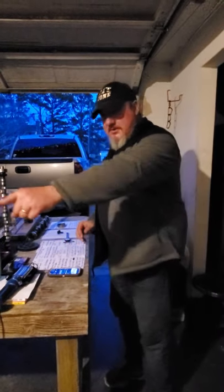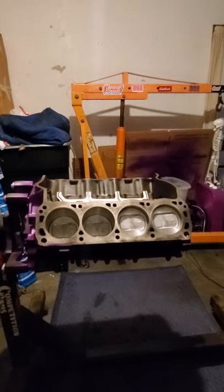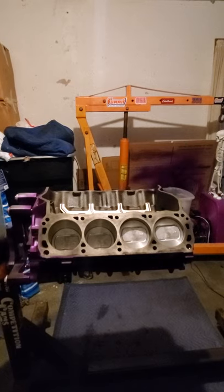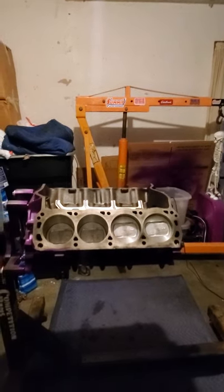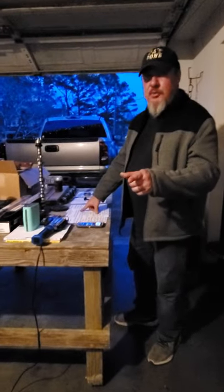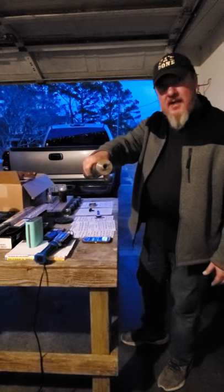Okay, so my engine, pan over to the engine. My engine is a 1984 351 Windsor. It's carbureted. So if you hear what he just said, and you can play it back a million times, he said the long dowel will be 1979 to 1985 carbureted applications. That is incorrect. Hence, why I lost $400.